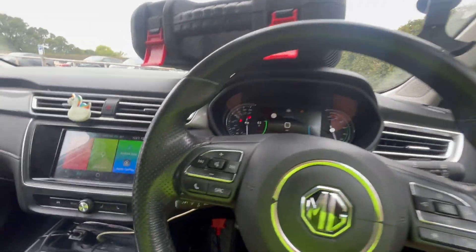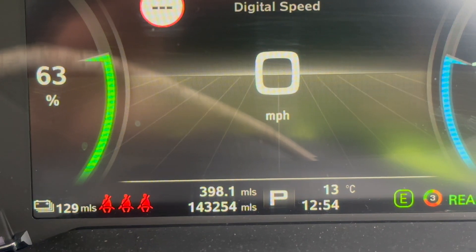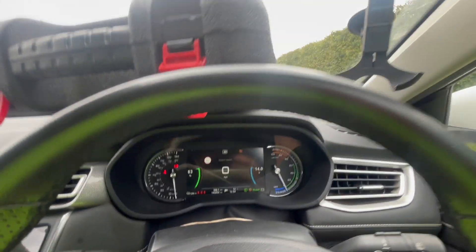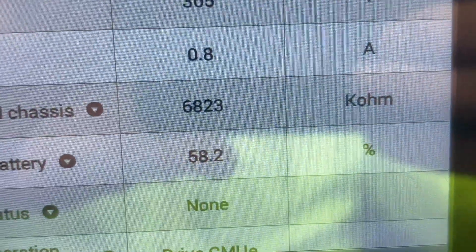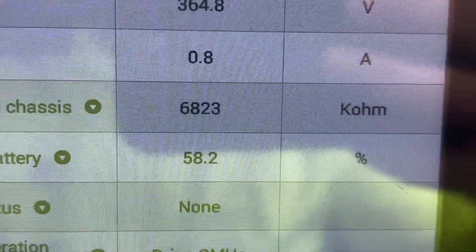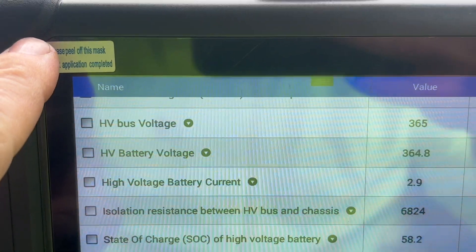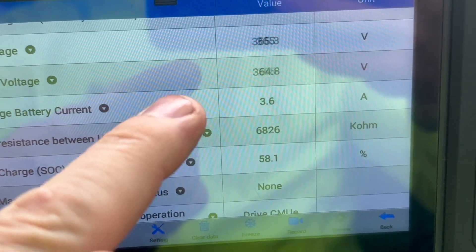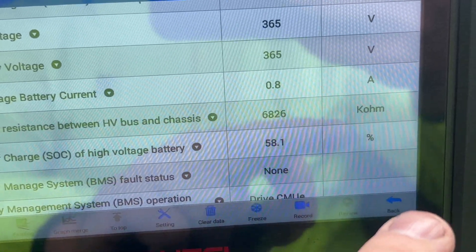Probably the mileage is what you want first. If I scroll down, you can see it's done 143,254 miles and it's at 63% state of charge. But on the computer you can see it's actually at 58.2%, because what you see displayed and what the state of charge actually is are two very different things. When you're at 100% on the display, the actual state of charge is normally about 5% below. They cross over around about 50% - there's a point of equilibrium where they're accurate.